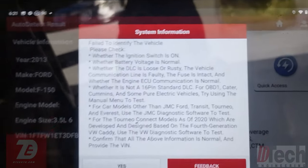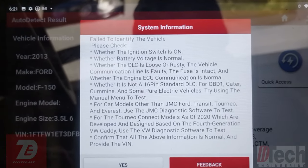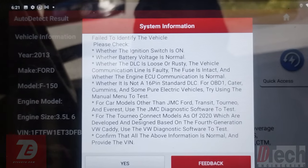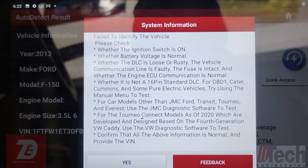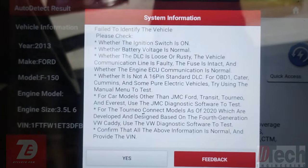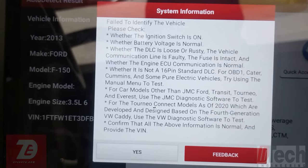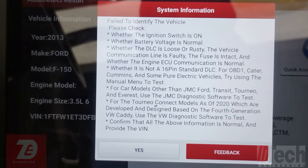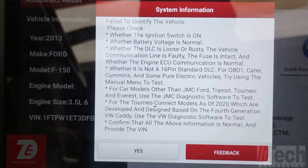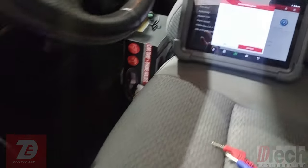That last 10 percent just hung there at 90% — it was stuck and cannot go any further, despite picking up the identification info. So yes, we can call it no communication with any of the modules. That's verified again — we're dealing with a bus problem.